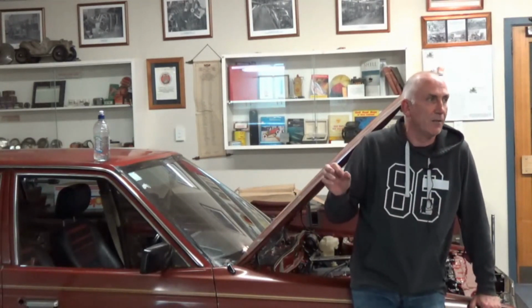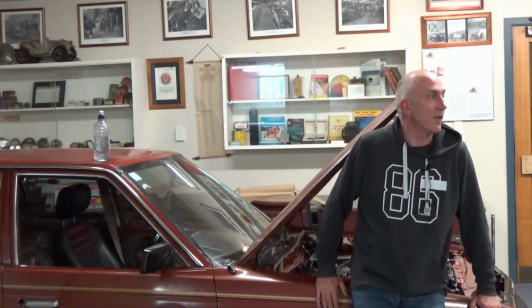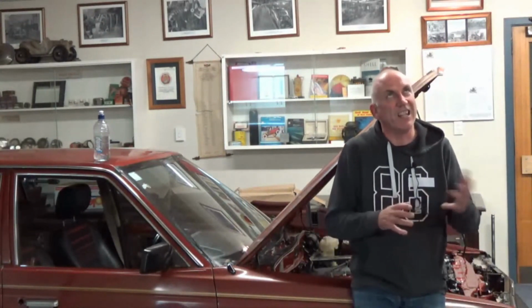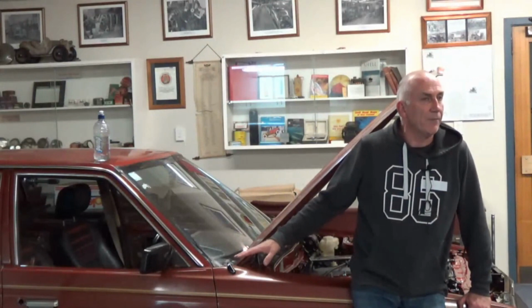And as I wrote about in one of the articles, I've done a Nissan 6-gear conversion in the gearbox, which gives it a taller 6, which cancels out the shorter diff, and it runs allegedly, or in theory, 40 revs more at motorway speed than it would in a stock car. So I'm really stoked, from at least a holistic point of view, where the gearing in it is fantastic for having a bit of a play.